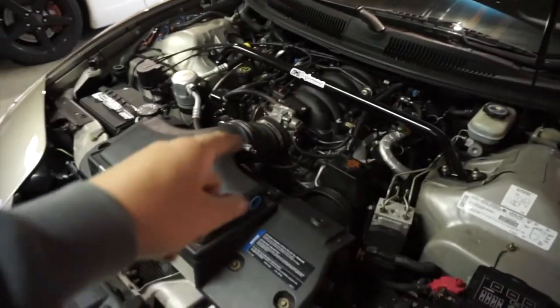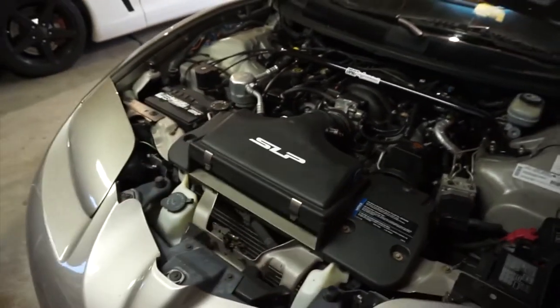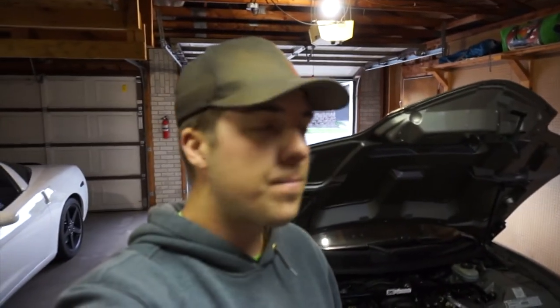For ten dollars, what it's doing is lowering the temperature of the throttle body itself — as much as 20 degrees, I'd bet, if you drove further or were in stop-and-go traffic. This is on a 40-degree day, so that might be exacerbating or reducing the effect — I'm not a scientist. That's how much it cools the throttle body, not the intake air temp, but you can infer the intake air temp would be cooler similarly. If you're interested in the exact kit, it's from Pot Speed and Performance on eBay — about a 10–15 dollar kit, just one brass barbed fitting and two worm gear clamps. Super easy install, anyone can do it.